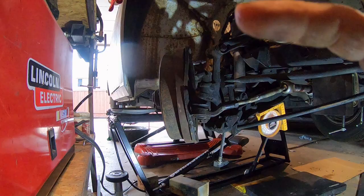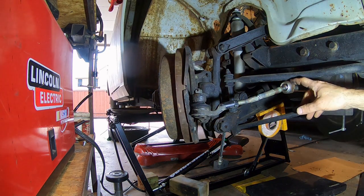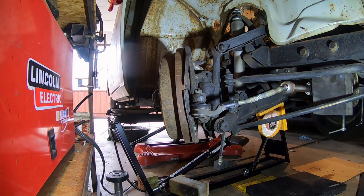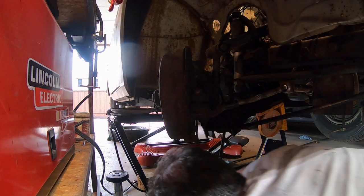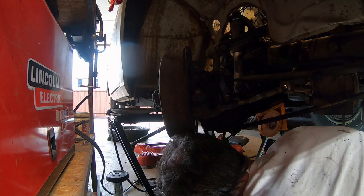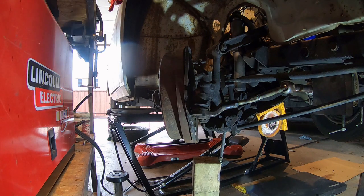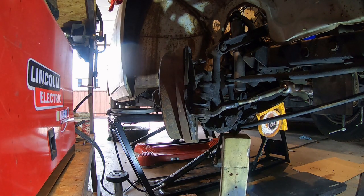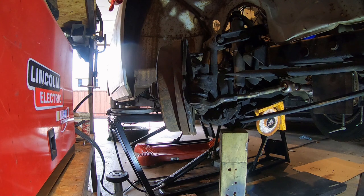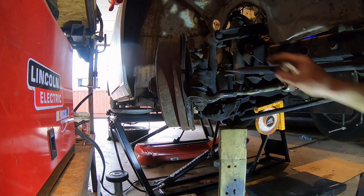I'm trying to make the mount higher. In order to get a little more angle I've got to raise the rack. The problem is it's gonna hit the sway bar, but that's not a big deal — I just have to raise the sway bar up a little bit. This is at full droop, remember. At ride height there's about right in the middle. Either way I've got to raise the sway bar and lengthen the rack a little bit — I see tons of room here.